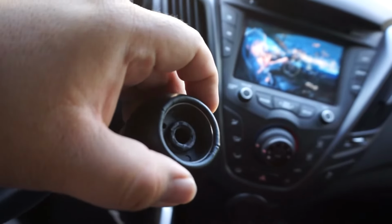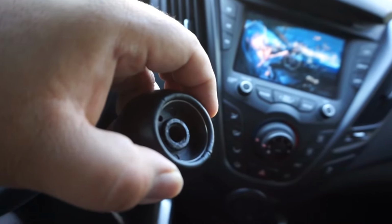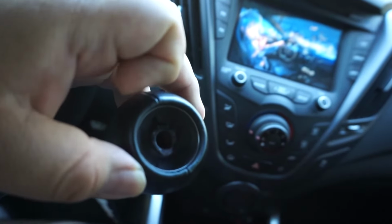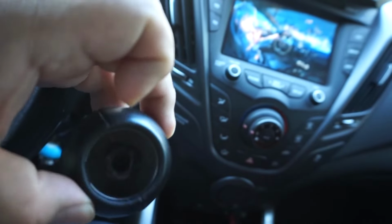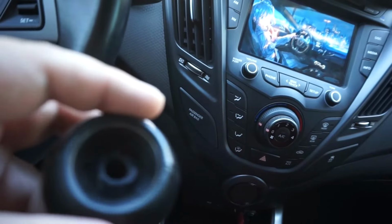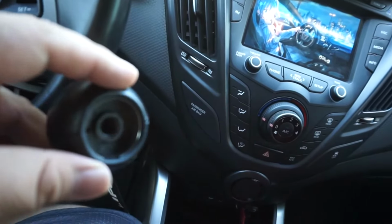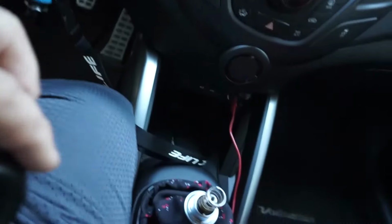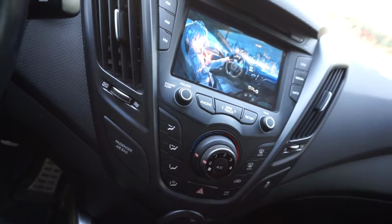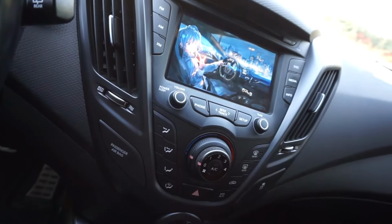And make sure that when you do buy a shift knob, also take into consideration the reverse lockout, because there's a lot of shift knobs that don't have it, so you'll have kind of an issue with those, or it just won't sit flush, it'll sit raised. So make sure it's 1/2 inch thread and take the lockout into consideration. For those of you that have the automatic transmission version, I'll just link you to the video in the description where we kind of go more into depth.